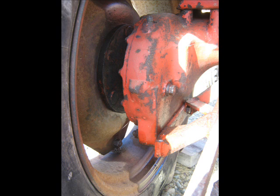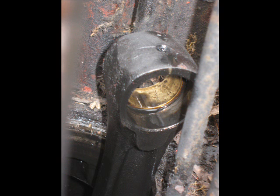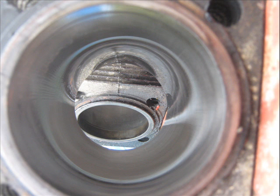Leaky oil seal there in the rear left-hand side wheel. Piston there — the left piston. The top ring broke and chewed the piston away. The bushes, the piston pin bushes. Half a bush in piston number one. Number two, the bush came out with the pin.